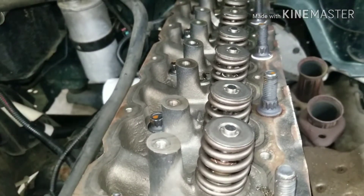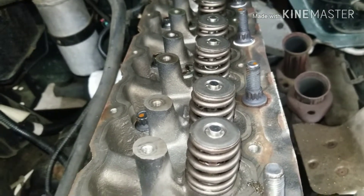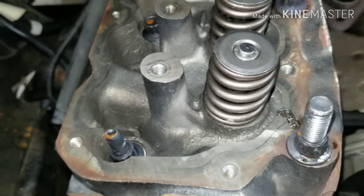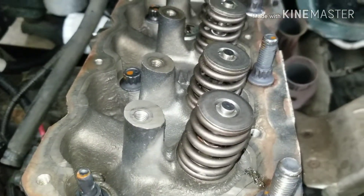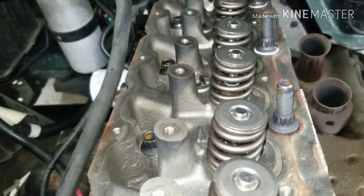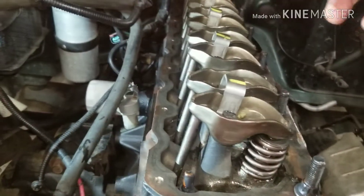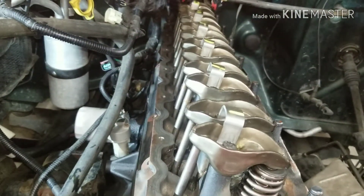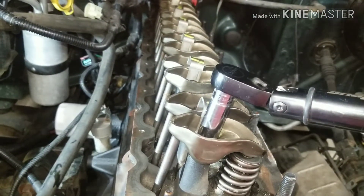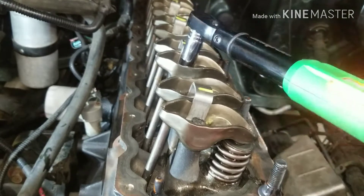Once you get your head torqued, we're going to put our pushrods in — one in each hole — in the way we marked them. Then we're going to put our rocker arms back in and torque those down to 21 foot-pounds. You want to make sure everything is lined up correctly because you can bend a pushrod if you're not doing it right. I got all my rockers back in finger-tight, so we're going to dump some oil here so we're not dry on startup. These are all torqued to 21 foot-pounds because they're not adjustable — they're just a solid thing.